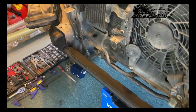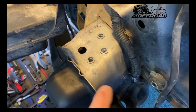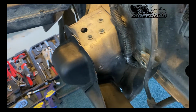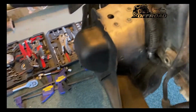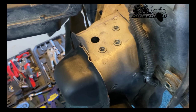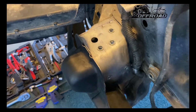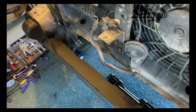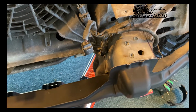Obviously there are pros and cons to that. Over here, the chassis doesn't have any original mounting holes to mount the winch plate and the brackets. I wanted to use a 10mm riv nut, but unfortunately you need to hydraulically press those in, and I don't have one of those. Only 8mm is the highest you can go with a riv nut gun.